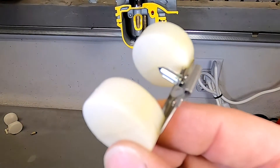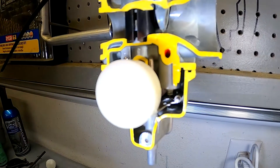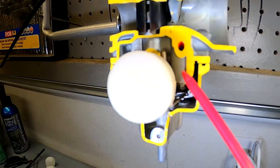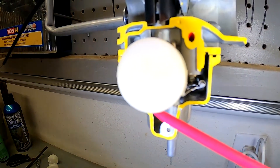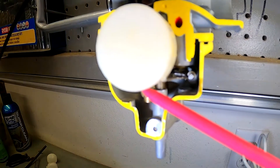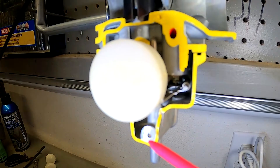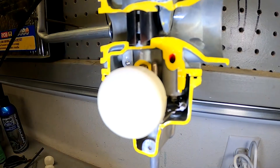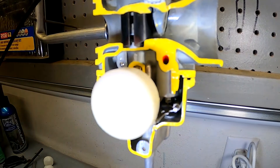First, you must get the gas inside the engine, and that's where the float and float valve come in. The float system in here is what meters the fuel. The fuel comes in here at this red port, comes down around that float valve, and as the fuel comes in this float floats — hence the term — it goes up and closes off the valve. When it needs more fuel, down it comes and more fuel comes in. All of this happens so that you can have a bunch of fuel at wide open throttle or very little fuel at idle without it all overflowing.